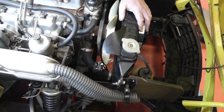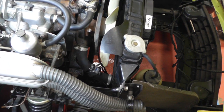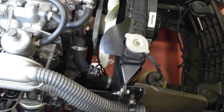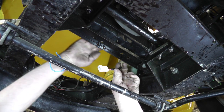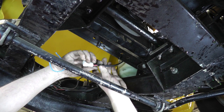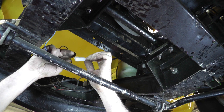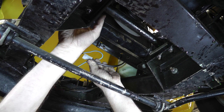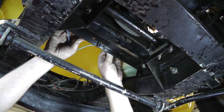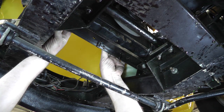I've routed the wiring down below and found a place for the relay. We're going to secure the wiring from the temperature control unit, connect the blue wire out of the relay to the red wire on the fan, and the black wire out of the fan to a good earth. One earth out of the relay will connect to the same earth as the fan. Once all that wiring is secure, we'll go up top and show you the last little bit.